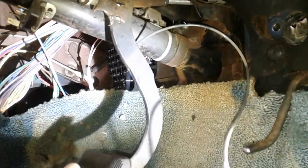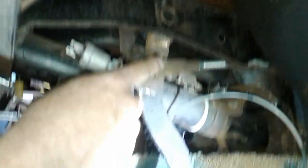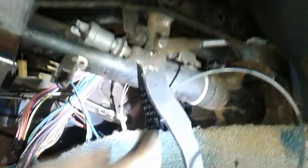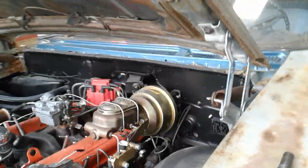Brakes are applied and I'm not going all the way to the floor. So if you've got manual brakes and you are moving to a disc brake setup, you need to lower the position in which your push rod connects to the brake pedal. That's all I've got for you today — still working on our 1960 Impala with a brand new brake kit.